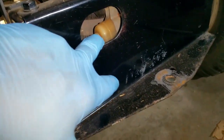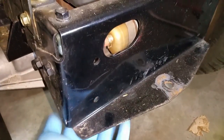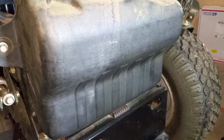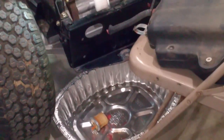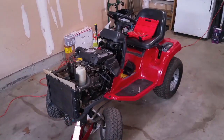My next task is to take out the gas tank and replace the fuel filter. The fuel filter is located right here and it is a pain to get to — the only way I can see getting access is either going from underneath, basically working blind, or taking the gas tank off which looks like just two bolts. So I'm working on it right now, I have the tank off, and my plan is to put the new filter on while taking the old one off — perfect success.